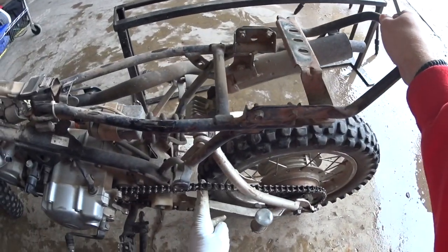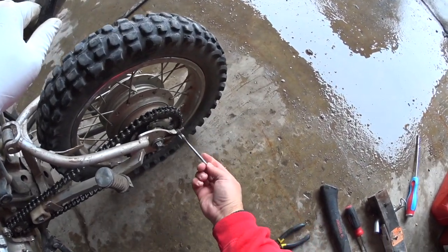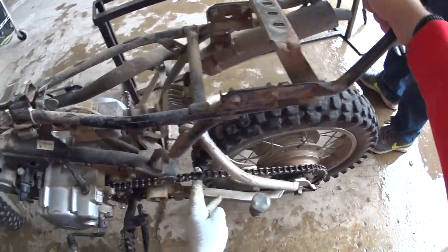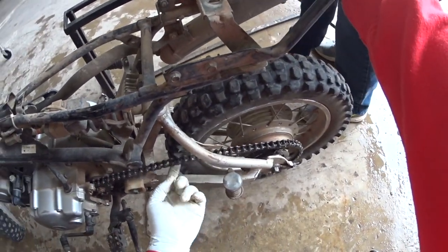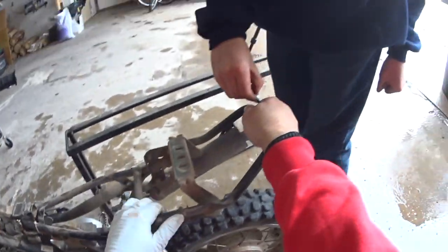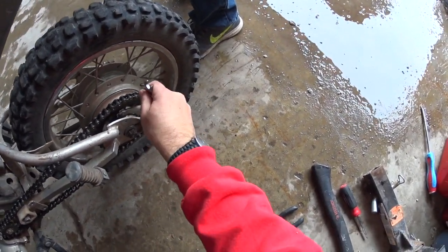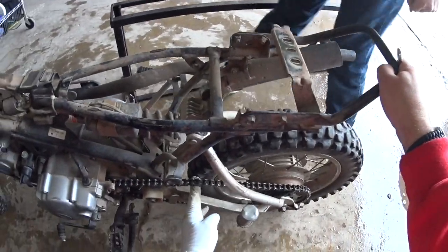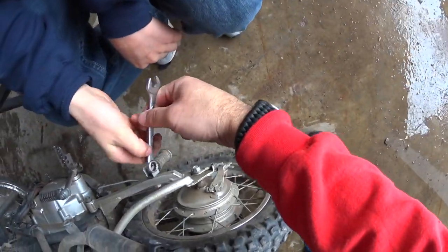Okay, so now I'm going to set. Now that's a little too loose. So now I can go back. Okay, we're about there. That's three fingers right there off the swing arm. Still feels pretty darn loose though. Yeah, I think we need to go just a touch further. And that's going to make it halfway between the middle mark and the one towards the front of the middle mark. Okay, so we'll adjust this one. Yeah, here. Counterclockwise.